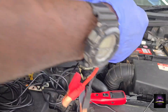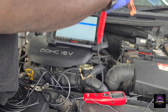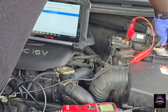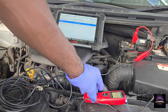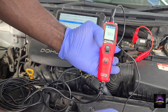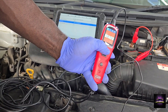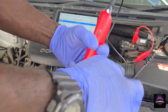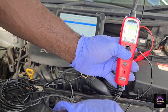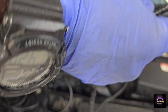I'm going to power it up by putting it on positive and negative — going directly on battery positive and negative. Once you put it on, it's going to beep and come alive. It's showing zero volts. If I toggle the switch up, it will send 12 volts — I'm reading 12.7 volts, so I'm sending 12 volts to the tip of the probe. If I press it downward, I'm sending ground to the tip.